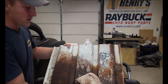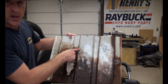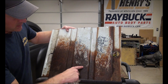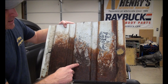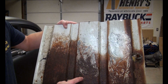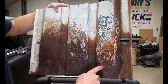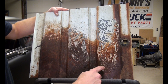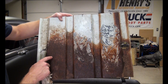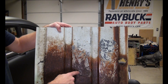And then the Rust Release — it looks to be similar: rust and dirt here, some paint taken off, and a lot of rust taken off down in the lower section. What I notice down there where the heavy rust was, it's pretty black — so you can see it already converted or started converting a lot of the rust. From the Evapo-Rust side I see a little bit of black, not a whole lot, but it does look like it started converting. Over on the Metal Rescue side, there's a little black in the pits, but not as much as what I'm seeing with Rust Release.